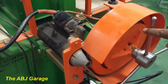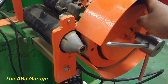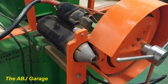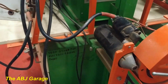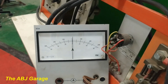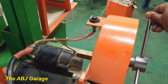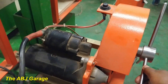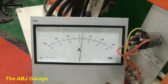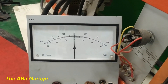Now let us apply load by turning this knob. The flywheel is currently free to rotate, but by turning this knob we will be applying pressure. Now it is not free to rotate. Let's do the load test — you will see the current draw with this arrangement has somewhat increased. Let's add load again. It has almost doubled to nearly 200 amperes by increasing the load on the starter motor.